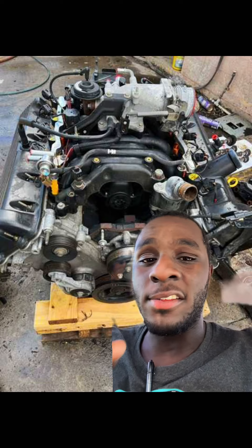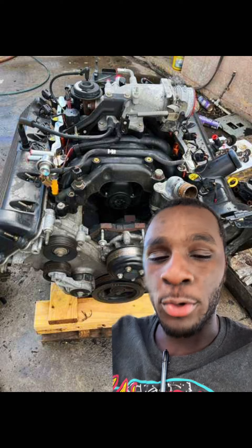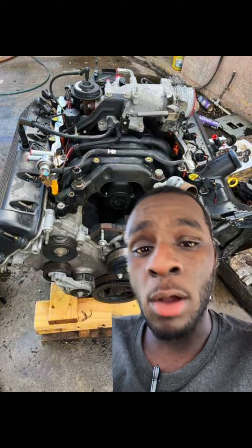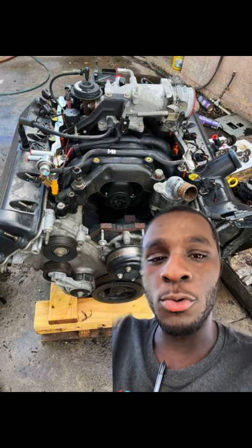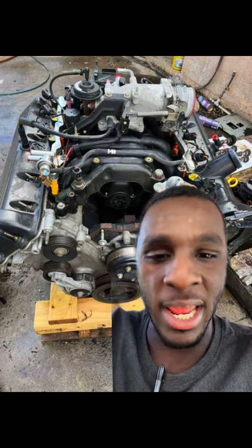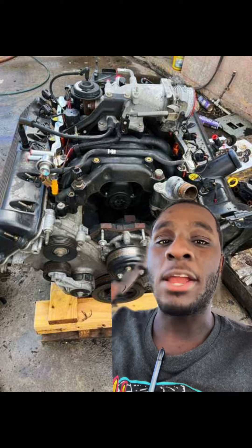To mod these things subtly you have to do some preventative maintenance, because the oil pumps and the primary chains on these things are absolute trash. When the chain breaks — and you will have a timing chain failure, it is imminent — it's going to break and hit everything. Like when you get in trouble but your siblings get an ass-whooping too.